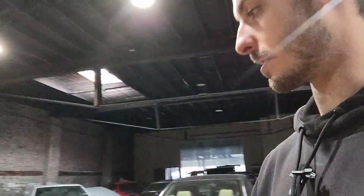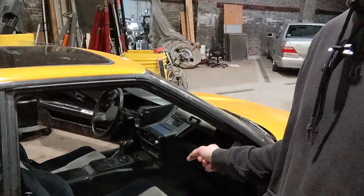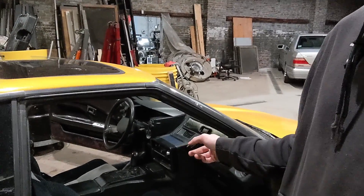I'm just excited to have a running and driving MR2 so I can compare what it's like driving on a kind of factory one. When I build my electric one, I'll have a baseline feeling for the weight balance and power. This one is turbo, which is sick. It's a five-speed and he says it has a six-puck clutch in it with the C52 transmission — pretty sure it's the supercharged model transmission. It does have the fifth gear pop-out issue, but he included an extra transmission with some good parts in it.